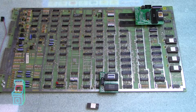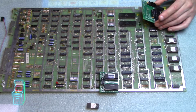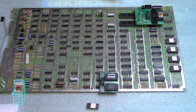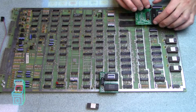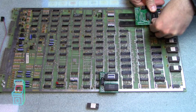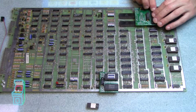All right. So the way I recommend putting it on is to tilt it to one side just to gauge where you're going to press down. And then when you put the other side down, it's nice and even. So again, the notch is going to face that way. Pin number 1 is that way, just like it was installed before. And it's going to be directly underneath here, and you're just going to push straight down. You're going to hear it click. There we go. So that's in.